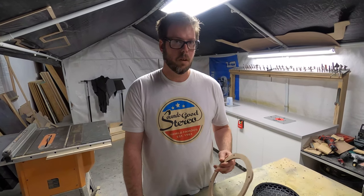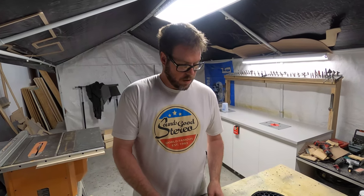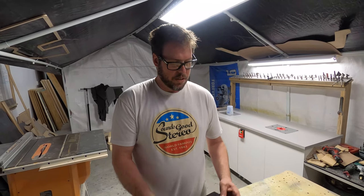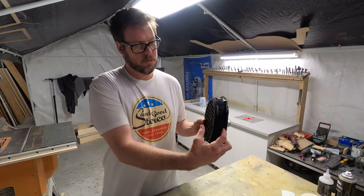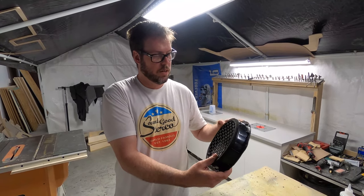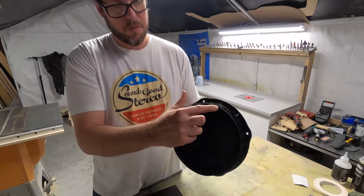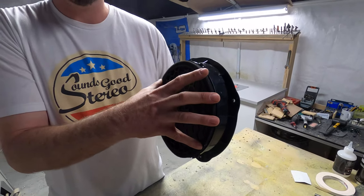And if you could, just for people that don't know, explain why the height is important. Like, why is it good to get that speaker manifolded back to the door panel? Because, you just said it. Well, basically, we want to bring the speaker forward. We don't want to mount the speaker all the way back in the door and leave a huge gap between the speaker mounting and the door panel. You can see this foam here from factory. That actually fits right to the factory door panel.